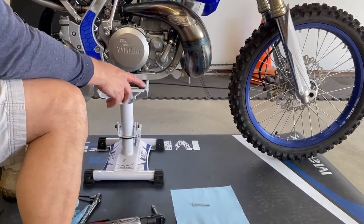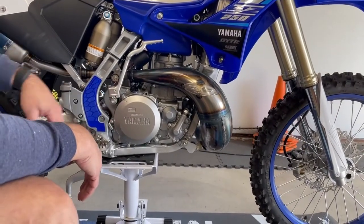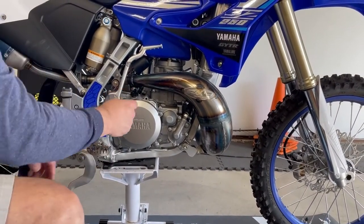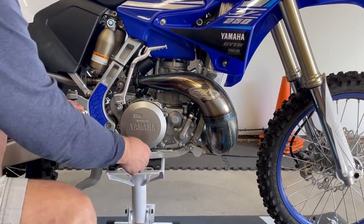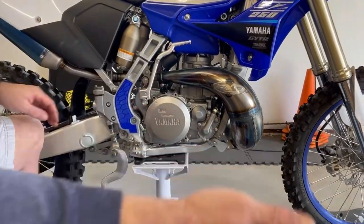One at the top. We have one bolt that's marked with a blue dot. It's identified by a hash mark on the cover. We won't be using this cover, we're going to be using a Hinson cover like that, but that's where that one goes. So far, all the same length, except for the top one. So you can see, you take them out. Except for the top one, they're all the same length.